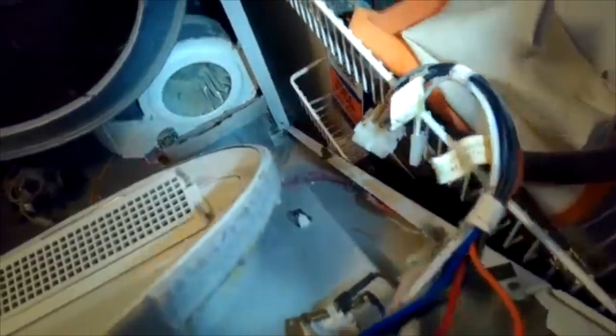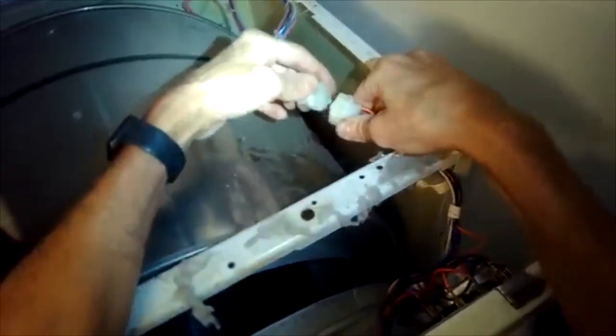Let's get the new timer in position. We're going to put the front panel back on by putting it on the little clips on the bottom first, and then push the front panel forward. Make sure you get the wire out of the way — pull that wire through and connect it back again.